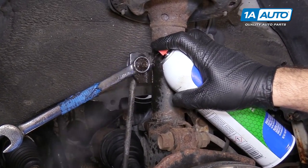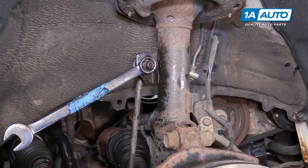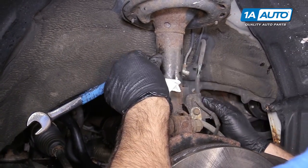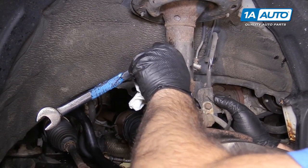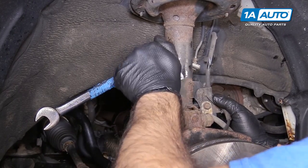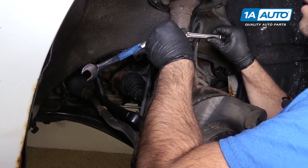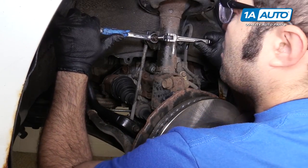I need some brake parts cleaner. I've sprayed some oil in there and I've been working the hex drive in to try to clean it out. I can see it's going in a little deeper. Try to get it to sit as best I can — I think that's as far as it will go. Let's put some more rust penetrant on there. I'm going to try to counter hold this with the hex drive while I free it with the 17 millimeter box wrench.